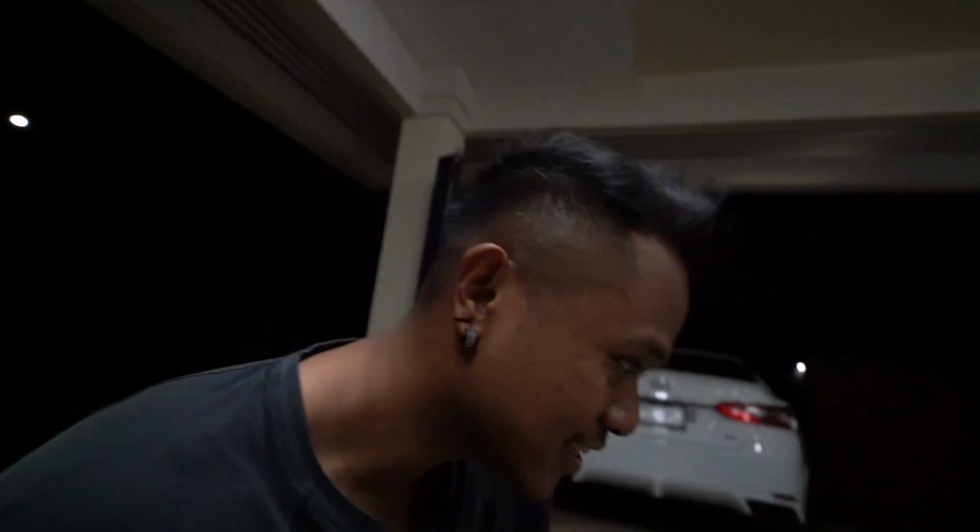Didn't really vlog because I was trying to rush and get it done, but we tried to crank out the fronts a little bit more to add a little bit more camber, but it didn't pan out because the tie rod is almost max adjust and the threads were hanging on by threads, literally. So we couldn't get the toe in spec, so we're gonna leave it as is. Maybe we'll try to figure it out later. Plus, the only way you could add camber on this setup, like I said earlier, is from the lowers because the top is maxed out. If he wanted more, he would go short to knuckle and add negative camber.